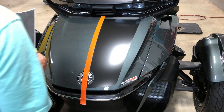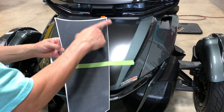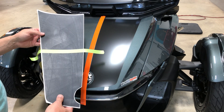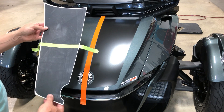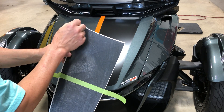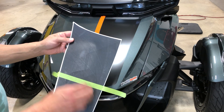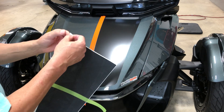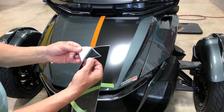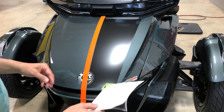Once the surface is prepped and you're ready to start the install, here's the second half of the stripe — this is how it will come to you. Over the years we've been cutting the stripes to shape to make it easier for first-time users to have a successful install. The center hinges on it. Over the top of the stripe is transfer tape. There's typically a little arrow with a red dot on one corner showing you where to peel after installation. There are basically three layers: the top transfer tape, then the actual graphic sandwiched between that and the backing paper. The graphic is sticking to the transfer tape, which is intended. Eventually both the backing paper and the transfer tape are discarded.